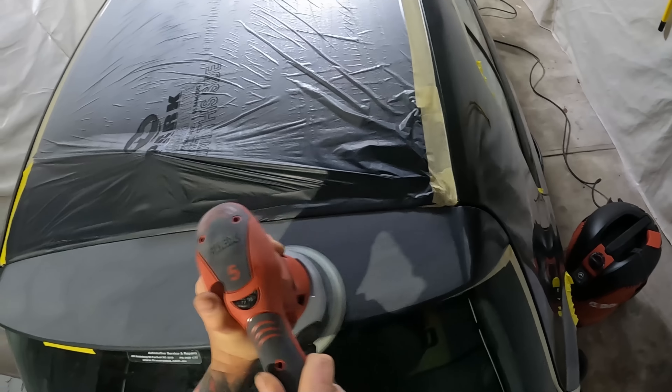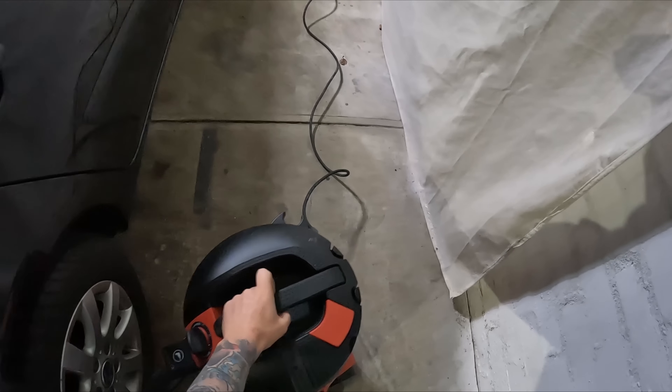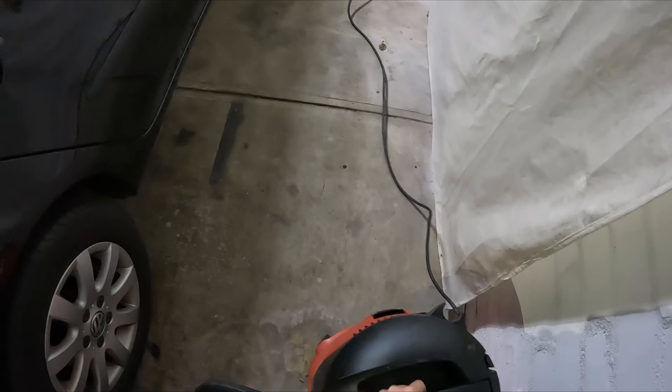That's about ready to go over by hand now. A quick buzz down with 320 grit — we're not going to want to paint over the 320, but it'll cut the orange peel out of the primer. There was no repairs there so I didn't block it. I've just got a bit of a box of tricks I've accumulated over the years — sort of a lucky dip. I'll eventually get a proper full set, but I'm slowly building up my supplies at home.